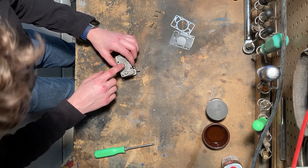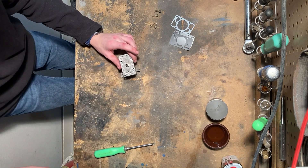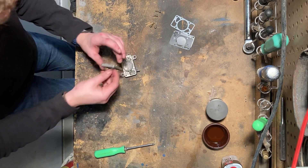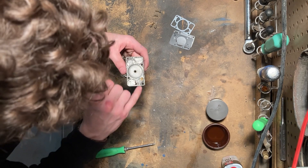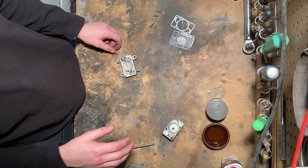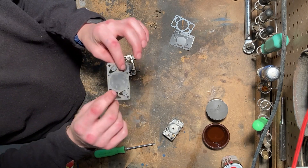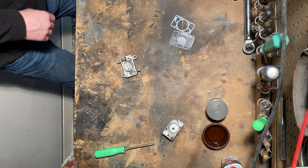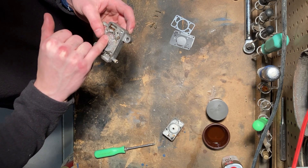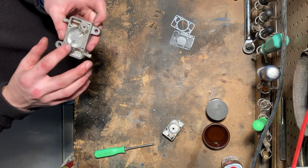This is where your pulse line connects — there's a barb on the side of the case that runs here, and as the pistons move up and down it's creating an oscillating pulse of air that runs the diaphragm in this pump. You can see there's some corrosion here and a little bit of residue from the old gasket — I'll clean that up with a brass wire brush. That's pretty nasty. I did have this apart already and got rid of the gaskets, but you can see there's gas gummed up in there and a little bit of corrosion, just from having a little bit of gas or fogging oil left in it. I'm going to clean out all these passages.